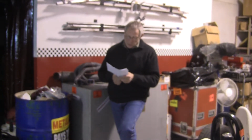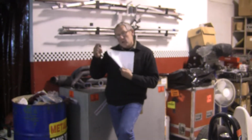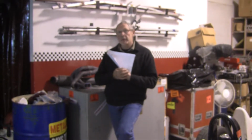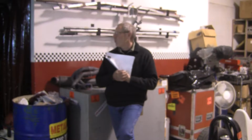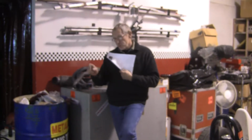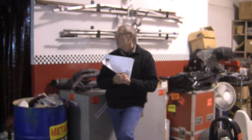Okay, so we talked about springs. Now, the other big part of the shock absorber thing is that the shocks you're talking about have got numbers on them. The shock we're going to look at up top doesn't have any numbers, it's just got little adjusters. And this doesn't have any numbers on it either. So where are you going to adjust them to and from? Once again, you need a datum, so you need to know whether you're going to work from screwed all the way in or screwed all the way out. And that will depend a lot on the type of shock that you've got and the way it's set up inside. So you do need to know that.